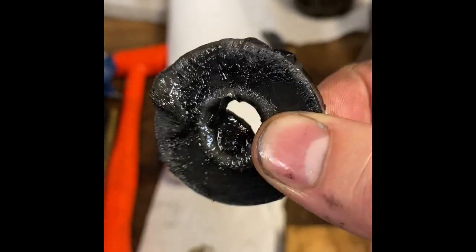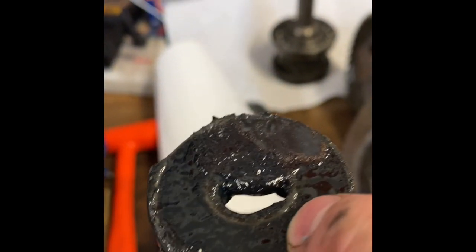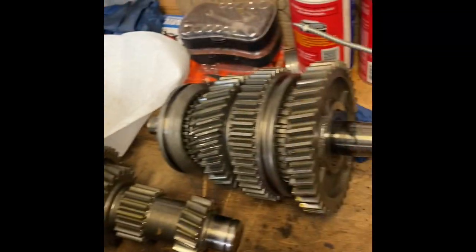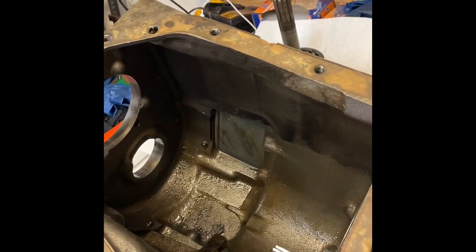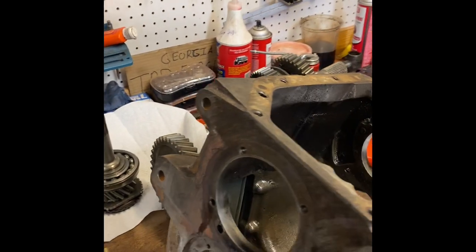You should probably consult your owner's manual before you listen to me. Well, I figured out why there was no metal in the oil — it's in the permanent magnet that was right down there. I should probably clean that before I put it back together. Either way, I've got it into all of its major component piece parts: case, main shaft, counter shaft, top cover over there somewhere in that pile. Now I've got to start pressing and cleaning and replacing and hopefully get this back together. Maybe I can make a drivetrain this weekend.